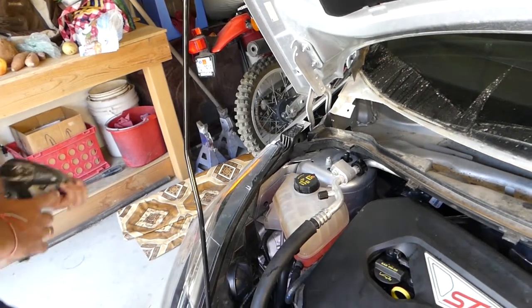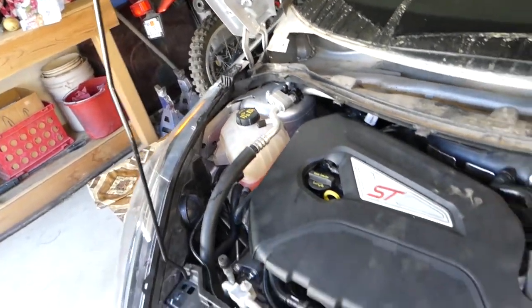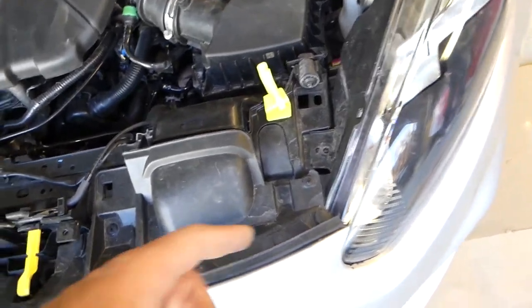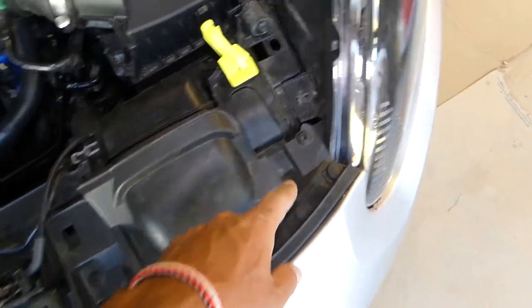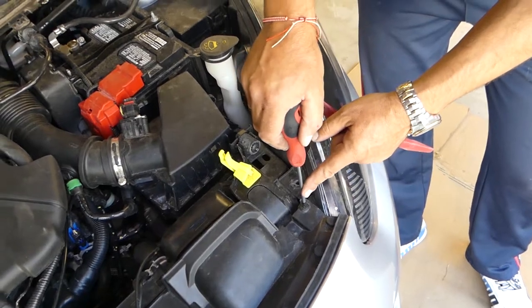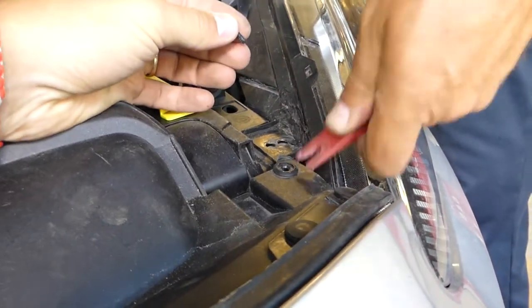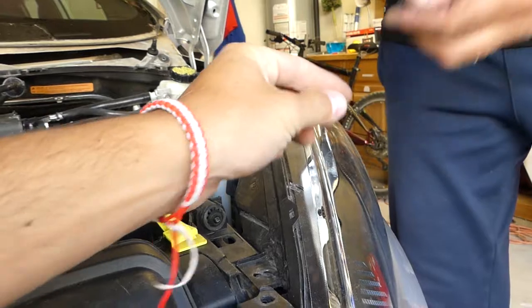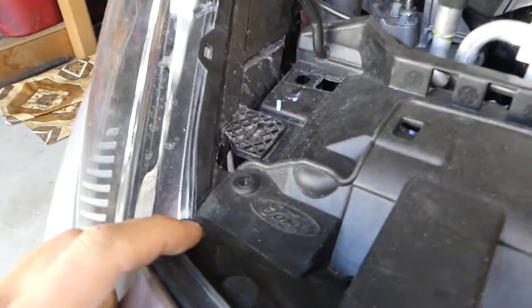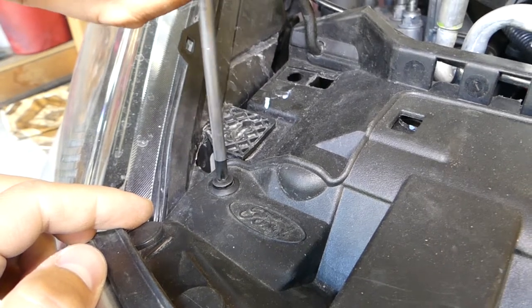Two screws done. Now we need to go ahead and get the panel removal tools and a screwdriver to remove these two clips - you can see one right here and one on the other side. We can actually go ahead and remove the headlights out of the way so we can remove that piece. You have to unscrew the middle part and once you unscrew it you can remove the clip. All the tools we use will be listed in the description below. Same procedure on this clip - we need to unscrew the middle part; sometimes they won't unscrew so you have to help them.